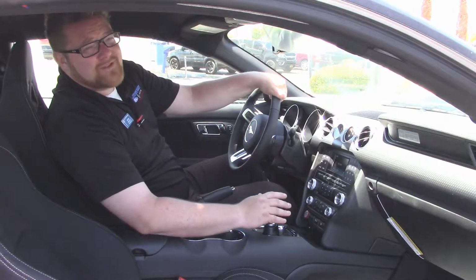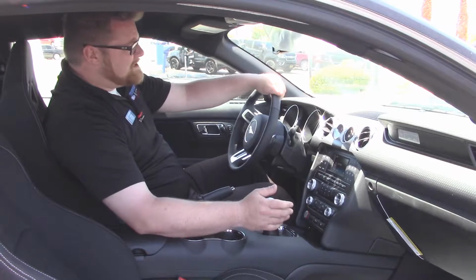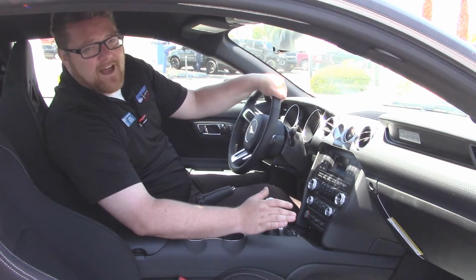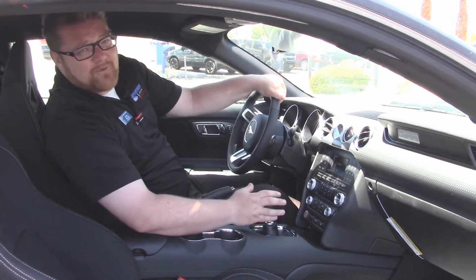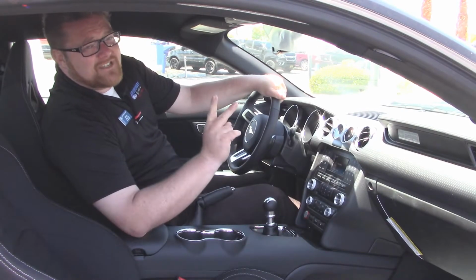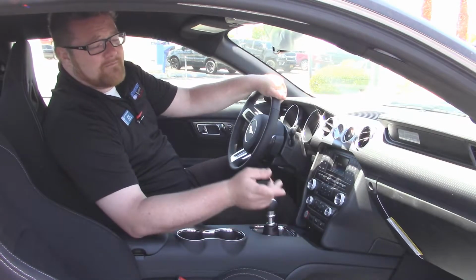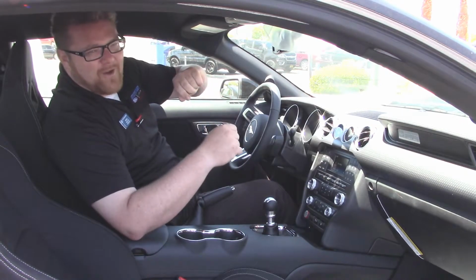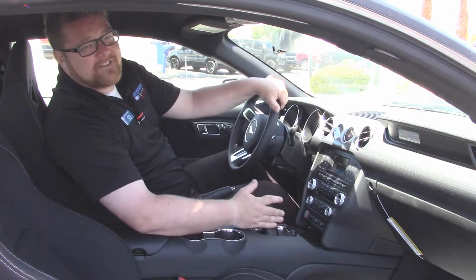Two things you'll find mostly in the supercar side of the car world. Launch control, which with a couple easy steps will hold an RPM between 3,000 and 4,500 depending on what kind of traction you're dealing with, and it will hold it where all you have to do is easily side-step the clutch and be on your way. Number 2, line lock, which was only in the dragster world before, will lock up your front tires and give you the ability to clean off any gravel or anything, and heat up the back tires, which I will show you in just a few minutes.